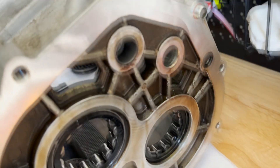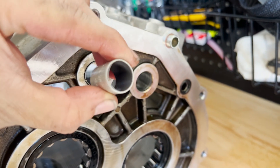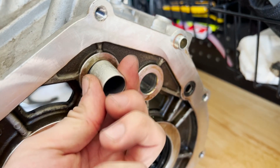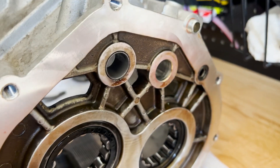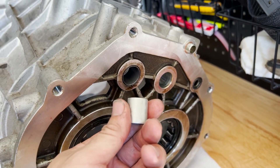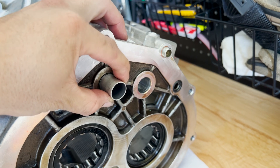You don't need to do that anymore. What we found is a step-down bushing with a PTFE-lined Teflon bushing inside that you just coat with Loctite and press in - and that's it. That is the step-down bushing you need, and it makes the job very simple, very easy, and very cost-effective. These things cost two or three bucks at McMaster-Carr.